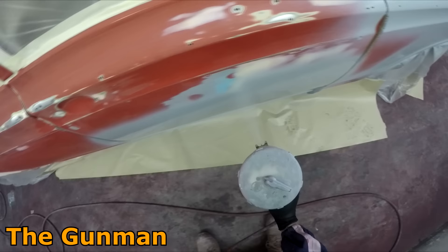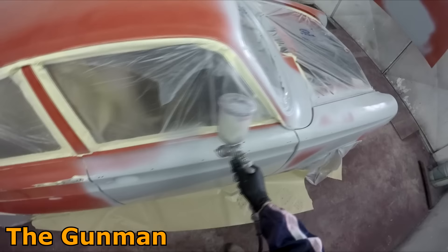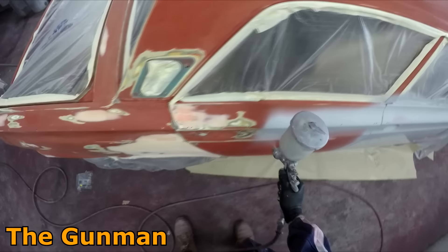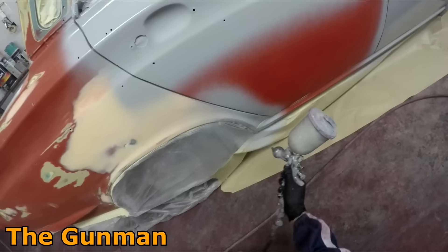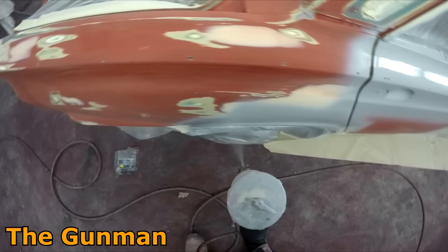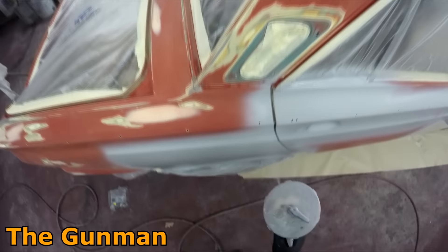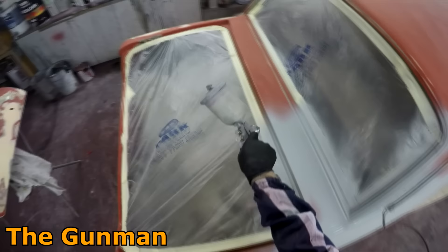I've got my infrared thermometer which tells me how hot I'm getting — don't go above 100 degrees. The gun I'm using here is the AirGunza AZ3 with a 1.8 mil fluid tip. I've actually since sold this gun. I got the DevilBiss GPI which came with 1.6, 1.8, and 1.4 mil fluid tips, so I decided that can be my primer gun — I'll just swap it to the 1.8. I did a review and demonstration on that gun recently so go check that out on my channel, including all the different needles so you can see how each one sprays.